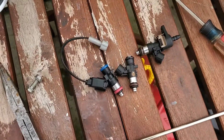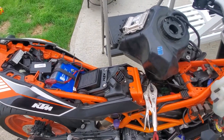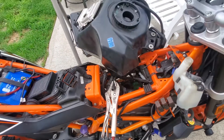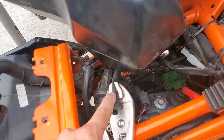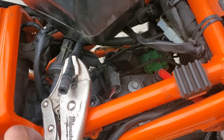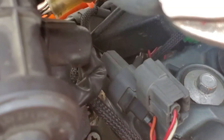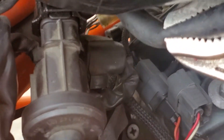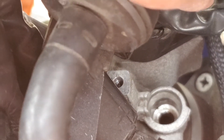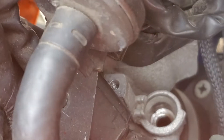Installation is fairly easy. Obviously you want to remove all your plastics. I usually just leave my tank off to the side, but for this purpose I'm changing the injector — I just pinched off the hose and set that off to the side. Down here is actually where the injector goes. The clip here is very easy to get to, and it just seats inside that hole. There's also a mounting bolt for a bracket with a T25, and it's kind of hard to get to.